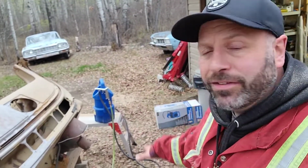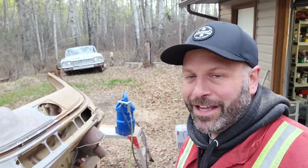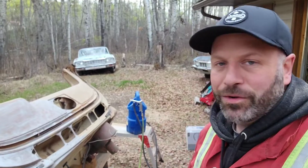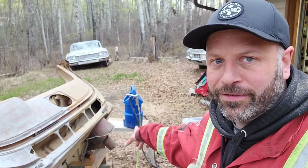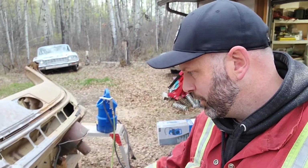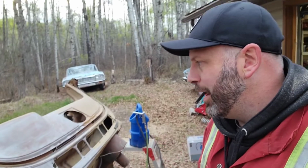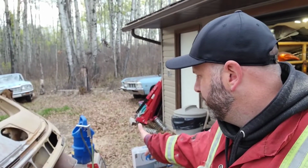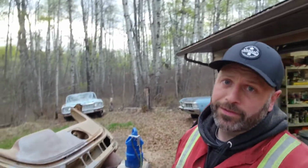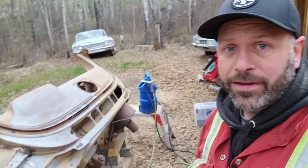But, you know, I've only got a 60-gallon air compressor hooked up to it. You know, if you're expecting to get the results from a true sandblast place, it's not going to quite happen for you. But you can do little pieces like the glove boxes and stuff. Probably be decent for that. Little trim pieces or whatever. Small little pieces you can do with it. It is handy for that. So it's decent. If I had nothing, I had to drive like 1,000 kilometers to do this, I'd just suck it up and get 10 more bags of sand and sit here for a week and do it.